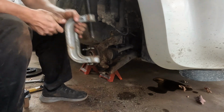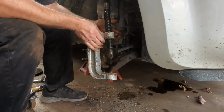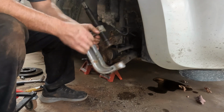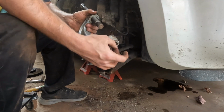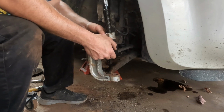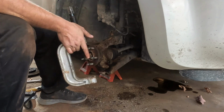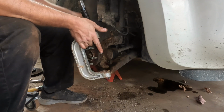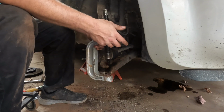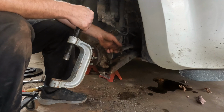And the way that I go about fixing that is with one of these. You can rent these at auto parts stores. They're actually a ball joint clamp, or ball joint press, I guess. Made for pressing them in and out of there. But what I do is the stud goes through here with the nut on it, and I get, of course, a socket there. Then I get something up here to kind of put pressure downward on that joint. Once again, you don't want to push just on the soft spot in the center. So I had a little metal disc up there just to evenly distribute the weight. But when it pushes that stud down into the steering knuckle, the taper gets real tight and it holds it in place. And I was able to spin that nut far enough to get the hex head at the end so I could tighten it properly.